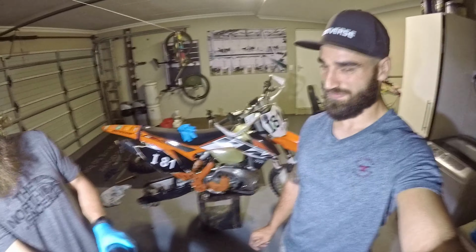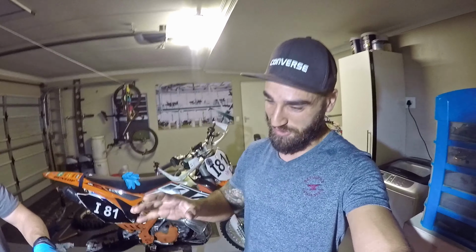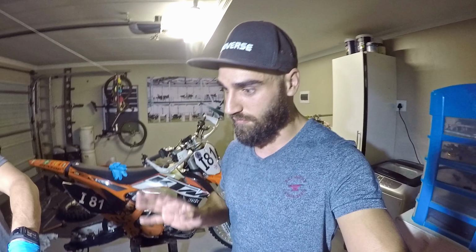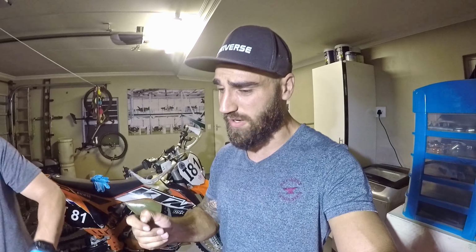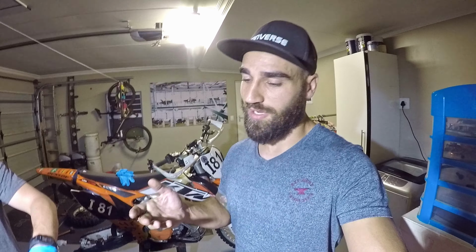So Rickard, why are we applying this lube here? So obviously the reason you want to apply mousse lube, sorry, we are very, very childish and inappropriate. Like I said, we're not professionals. Anyways, the reason you want to lube the mousse is so it just lasts longer. You don't want it to dry out because it'll start to deteriorate. So this just extends the lifespan of the mousse a little bit. And if you ride through a lot of water, you have to lube your mousse more regularly.